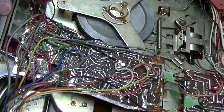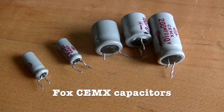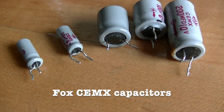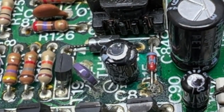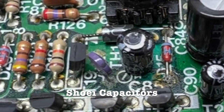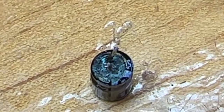That leaves the remaining electrolytic capacitors on the board. Quick comment about capacitor quality. Here are some almost 60-year-old capacitors I removed from the IWA machine. These devices are dead, but not one has leaked. I'm going to contrast that with 40-year-old capacitors I removed from a Tandy Model 100 — all those capacitors were dead, and they leaked. That clearly shows that not all capacitors are manufactured to the same standards. Always buy the best capacitors you can afford.